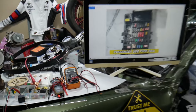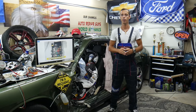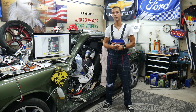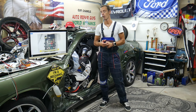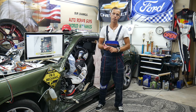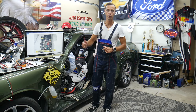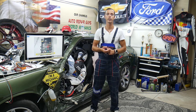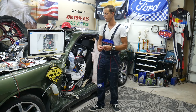Consider this video for entertaining purposes only. This video is not a how-to video because you have to be qualified and certified to work on airbag systems — otherwise it can be catastrophic. You can get hurt or even killed. Quick reminder for any of you that is qualified and certified to work on airbags: you have to disconnect the car battery for at least one hour, even when just checking an airbag fuse. You need to know which battery terminal to disconnect and reconnect first — that way you do not burn modules or computers that can cost you thousands of dollars in repairs.